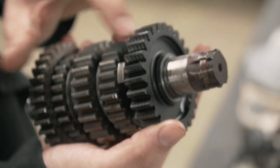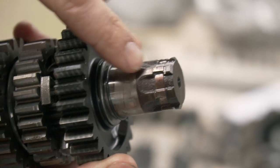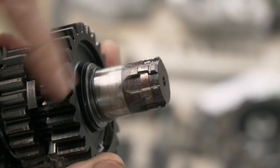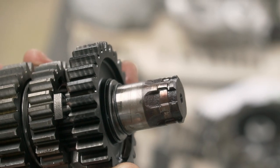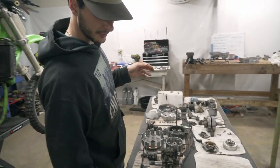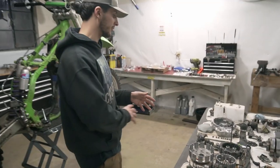We also have to swap over the transmission shaft. The bearings are fine, but the teeth of the sprocket — it's supposed to be this thick but it got cut down, so the front sprocket has a lot of play and that's just going to get worse until it starts spinning. So we're replacing that shaft. We already got the rest of the parts: the carb, kickstart gear, shifter, rear brake mounts, the head, cylinder, power valve assembly — so that's all clean.